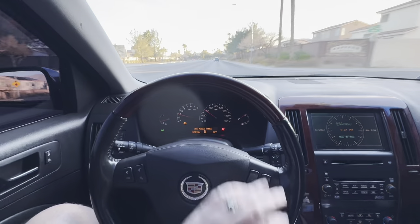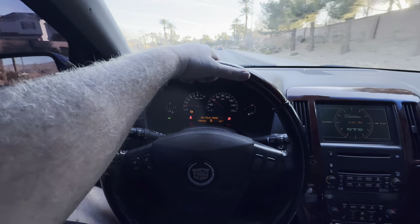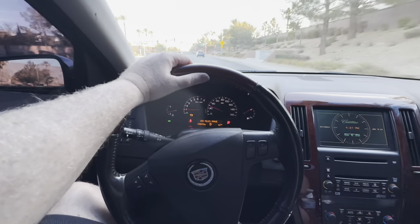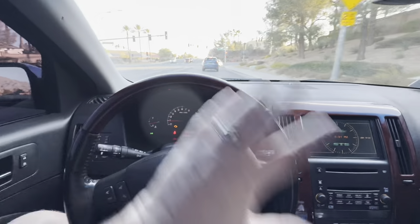She's running. Tomorrow we've got coil packs coming in, and then I'm doing spark plugs. We'll see if there's oil in the plug wells, which would mean valve cover gasket. Just general maintenance — that's all this car needs. One of the things I like most about this car is that it's American and parts are readily available. Unlike the GTO, which was basically an Aussie Holden where some parts were a pain to get — this Cadillac should be easy to source parts for, new or from junkyards.